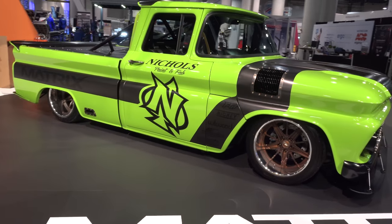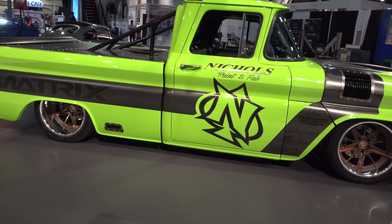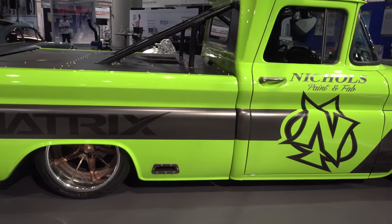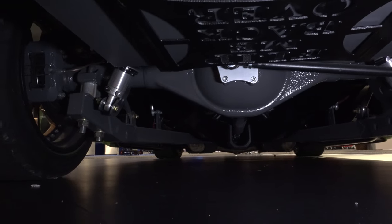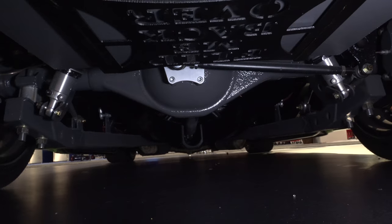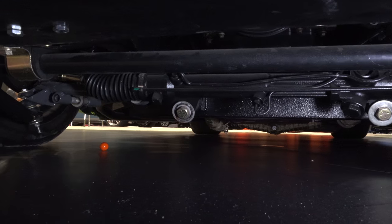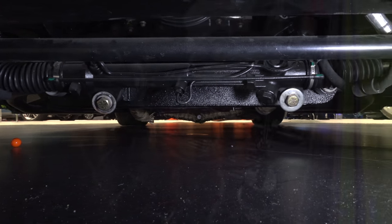We had to make everybody happy and keep me safe at the end — Pikes Peak's pretty insane. But it'd be fun to do; I think we've all dreamed about doing it. What about underneath? We built the whole chassis — we basically backhalfed it. It's got stock-style trailing arms with fully adjustable coilovers, sway bars front and back from Curry, and an independent front end. It just handles like it's on rails. It sits nice and low too.